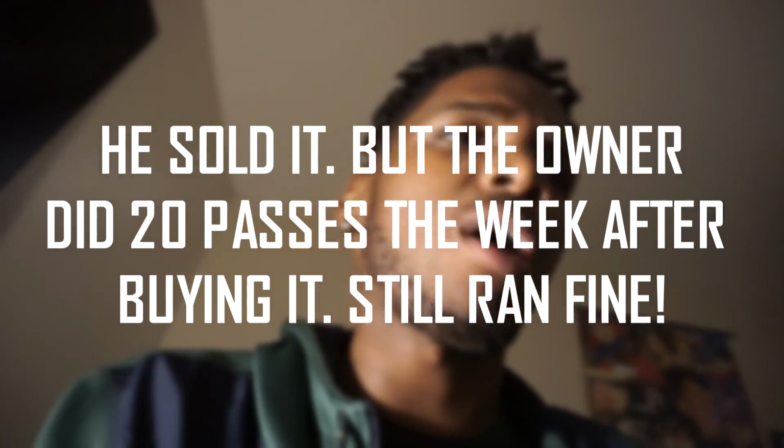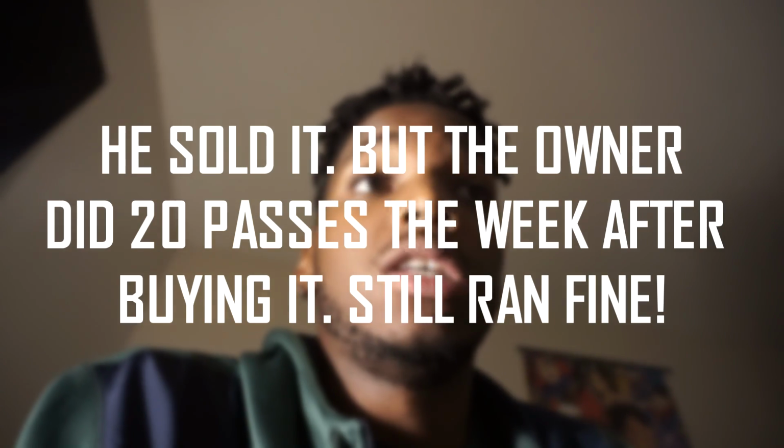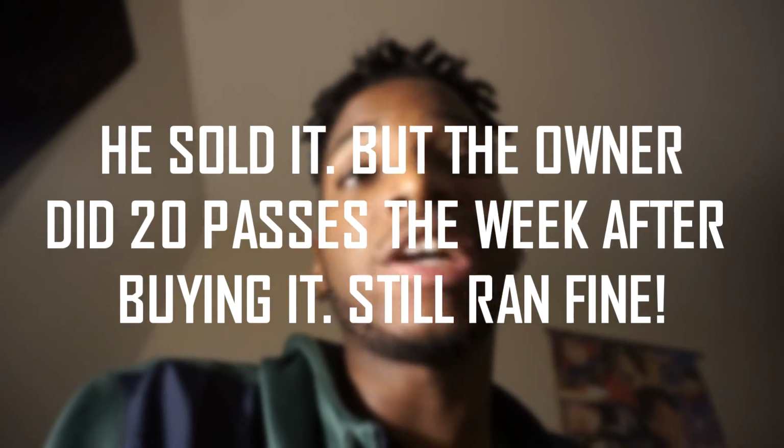Like, if you watch Honda Street Garage's video where he talked about whether you need ARP rod bolts and head studs to run a B20 Vtec, his boy Charlie ran a street beast B20 Vtec turbo, and till this day it still runs. So, generally what people would do if they're running a boost build or a high compression all motor build, you want to run the ARP rod bolt so you could rev to the heavens, because usually that's the weakest point of the B20, if I'm not mistaken.